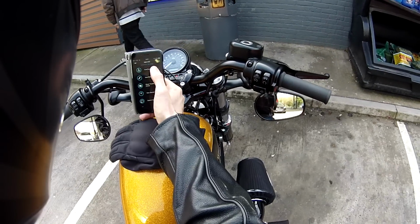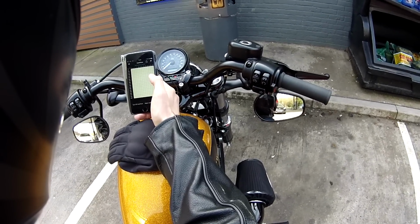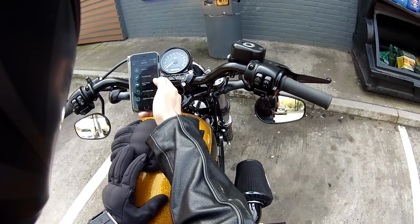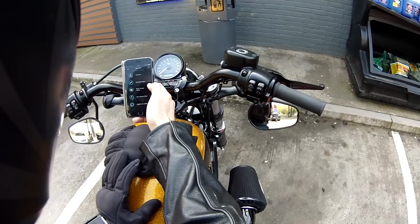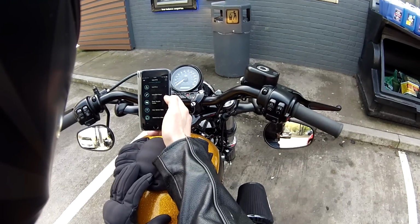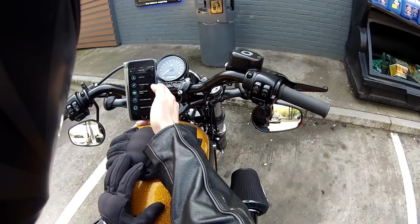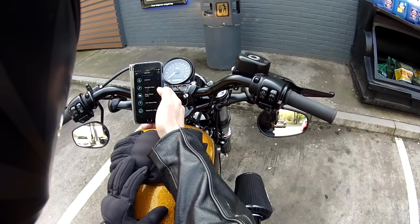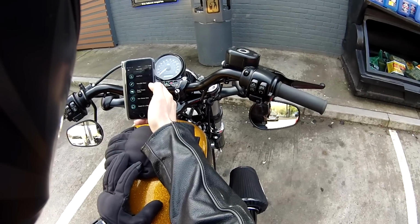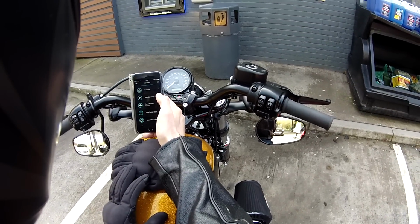So I'm going to keep my auto tune on. I'm just going to check that it's still on, which it is. Go back. And then what I'll do is take it further for about another 15, 20 minutes and then see how much more information it learns. Now, speaking to the guys at HD, they think that to get all the information that you need to get this bike really finely tuned, it's about 3 tanks worth of fuel. So what you're looking at is probably the 70 miles a tank, 7, 14, 21, 210 miles in total.